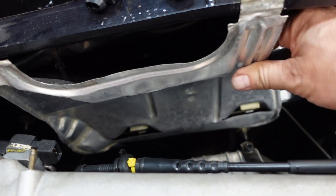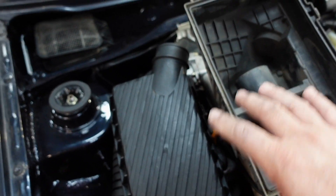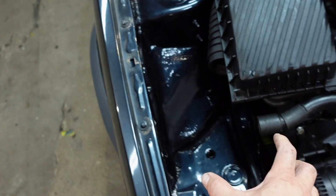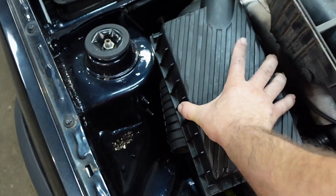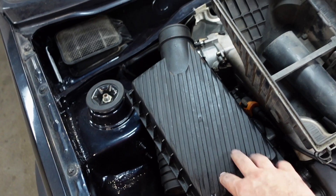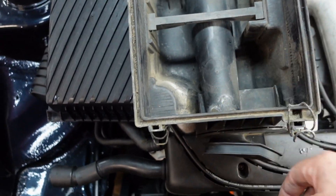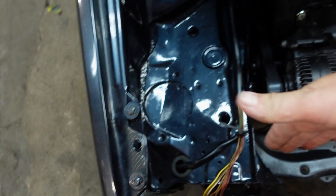Okay, so that's a nice fit. Now I'm going to show you guys what I've done with the air box. This is a 1.6 mark 2 Golf GTD later spec air box, which has lines on it. The early ones are actually smaller, which are perfect if you're doing an EBF in a mk1 - they've got the skinny type air box. These have the more square ones, not so thin. This is the top part of the GTD - it doesn't have a velocity stack.